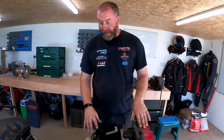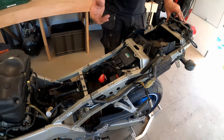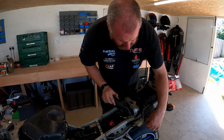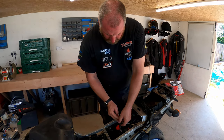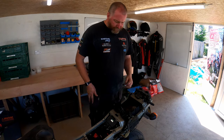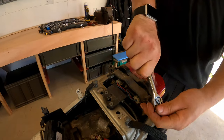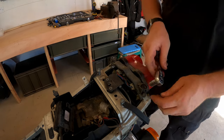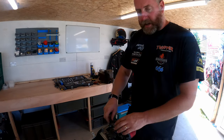So what I'm going to do is start stripping out the back end of the bike. The undertray needs to come off, along with everything fitted onto it - the CDI unit, starter motor relay, reg-rec, all that good stuff. We'll get away with just cutting out some wiring and then unbolting stuff to see what we can salvage for the rebuild. I'm starting at the back, and I'm expecting some of these fasteners to fight me because they've been in there a long time - steel fasteners into aluminium frames do like to corrode together, particularly if this has been ridden in all weathers, which it certainly has.